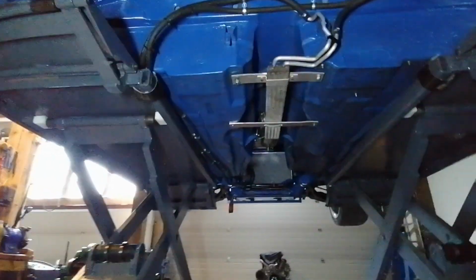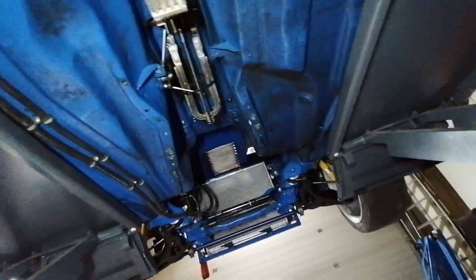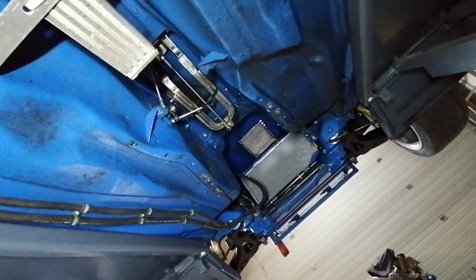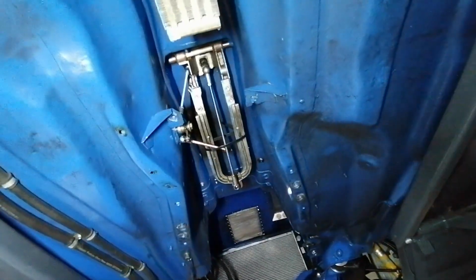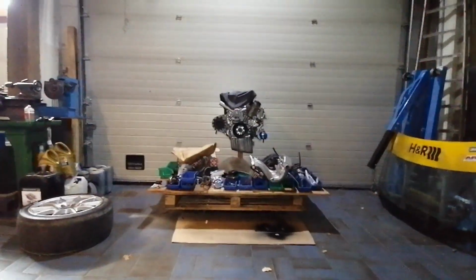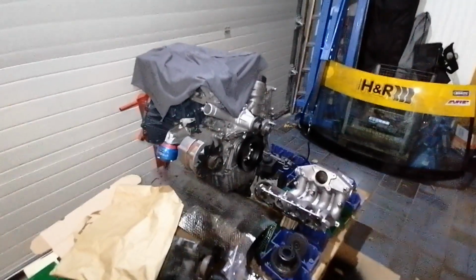Now we are talking about the future. So the drivetrain will stay nearly the same with the 6-speed gearbox, but I will change some things to make it lighter. I will use a newer one, the one I used in my OM605 and M104 Turbo, which doesn't need this linkage here on the side. So I will also change the whole shifter linkage. And the engine is also one of the crucial topics, but for this I will do a separate video, I think, to go into more detail.